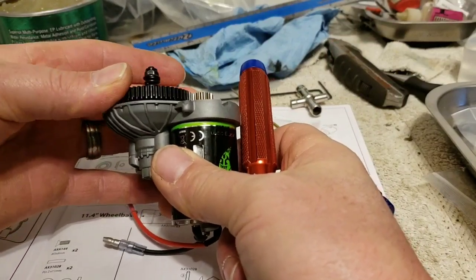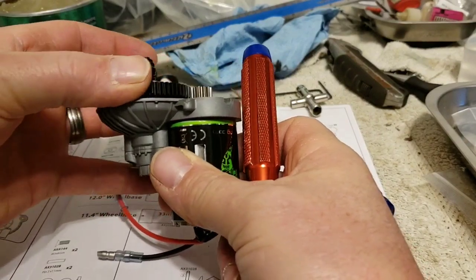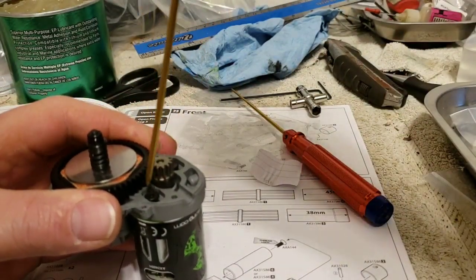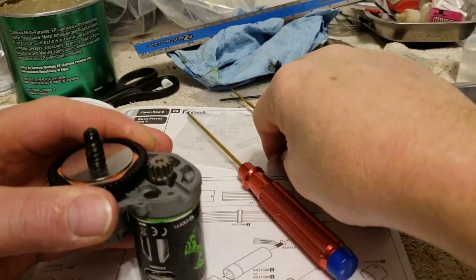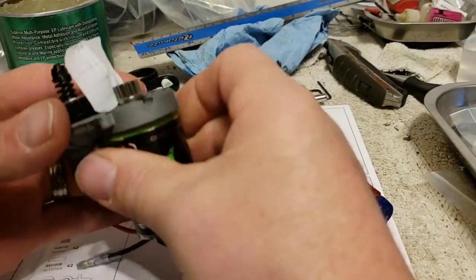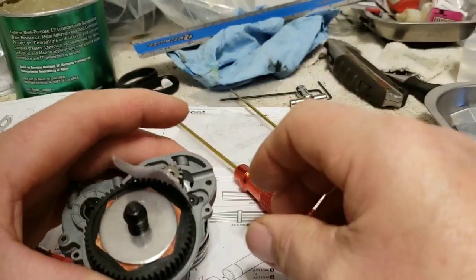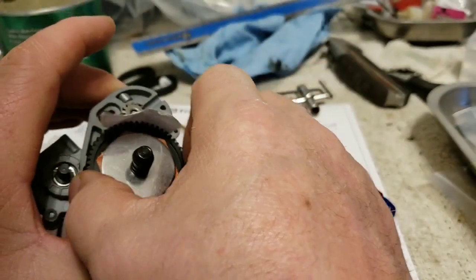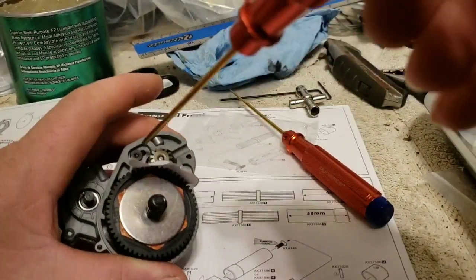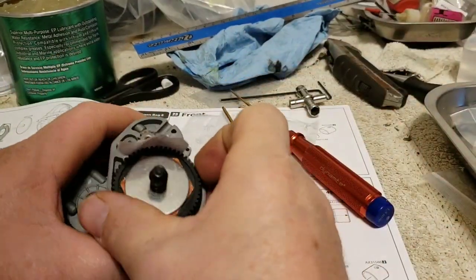Looks pretty good. Now, right there is a tighter spot on this gear than the rest of the gear. So what I'm going to do is leave that there, loosen these both up, and pull it out. Stick my piece of paper in there, just like setting antique points. Yeah, not many guys know what that means. Crank that down. Crank that down. And I did not kill them tight.